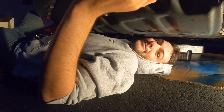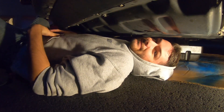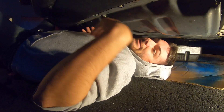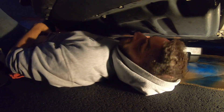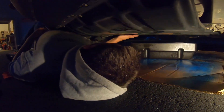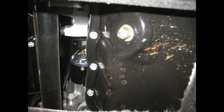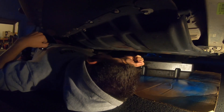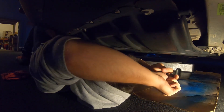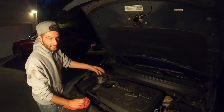We made our way under the vehicle. It's probably easier to do it with jack stands and a jack, or really just ramps or anything like that. It's a 13 millimeter on the drain bolt, and the drain bolt is on the passenger side of the exhaust — right here, there's a little opening. We're just going to drain that. Drain the oil from the pan — there's nothing left.